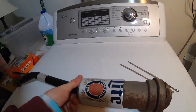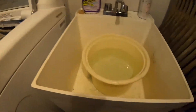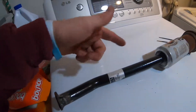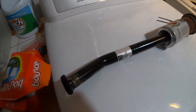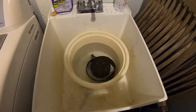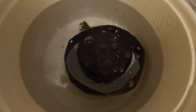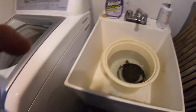What I'm gonna do right now is take this exhaust wrap and soak it in some water, then wrap it all around the whole pipe. The reason you have to let it soak is so all the bubbles come out — that way when you wrap it you're able to get more tension around the pipe.